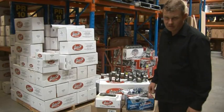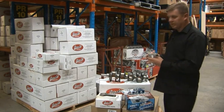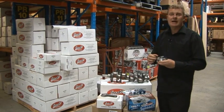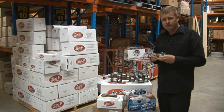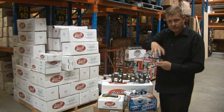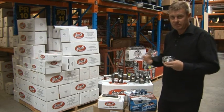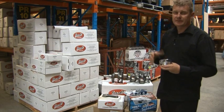The other important component that is connected to the conrod is the piston. Pistons cop a hell of a lot of load — imagine all that combustion pressure. You've virtually got an explosion happening on the top of this unit every time the spark plug fires, with all that downward force acting upon the piston. And the more power you make, the harder it gets. When you're running a lot of compression, say in a race engine, and you've got a bad batch of fuel, there's always potential for detonation.